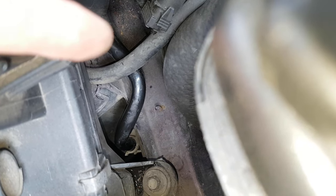Looking lovely, yeah, that's fine. Need two hands to do it. So to get that clamp back on, hook it in this end, got to hold on to it. I'll get around the other side, fit the bottom half of the clamp in, and just squish it together and do the thing up by hand. So we've got a few threads on, and then use the wrench to do the rest of it. And it all sits down like that. All looks a bit horrible and worn out down there, to be honest.